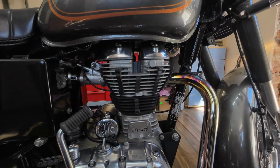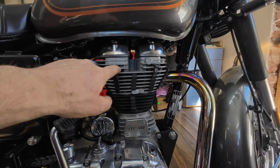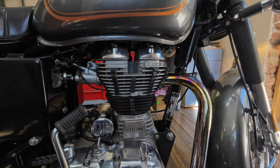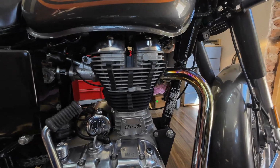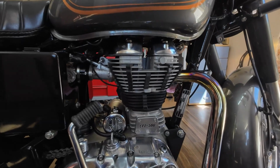It's slightly better than it was. I put a screwdriver to it, it sounds the worst on this push rod, which was the one that was extremely worn. Instead of it being round in the bottom, it looks like the shape of an eye. Your eyeball. But at least to know what it is. I'm going to order the parts, and obviously we'll get it fixed.